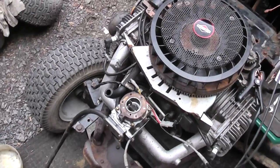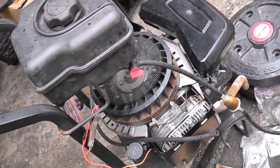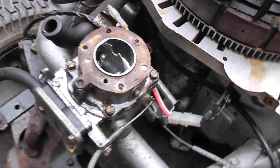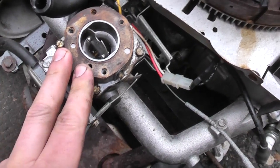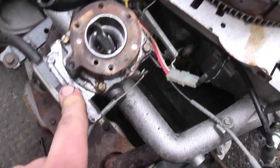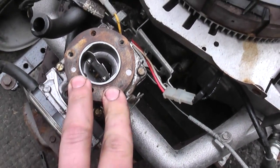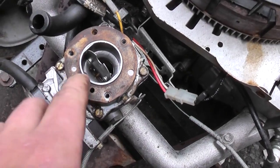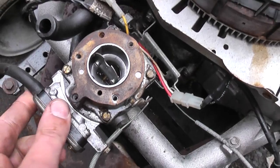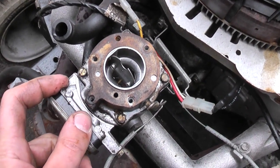So there were two bad coils — I stole one off of my other spare 16.5 horsepower. Inside of this was pretty bad; a couple things wrong with the pump. Got that working, found all kinds of corrosion — this must have been rained on a lot. Got that working half decent, but I think it's not happy with this carburetor because of the jetting.